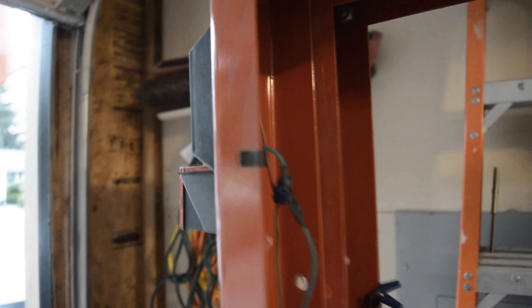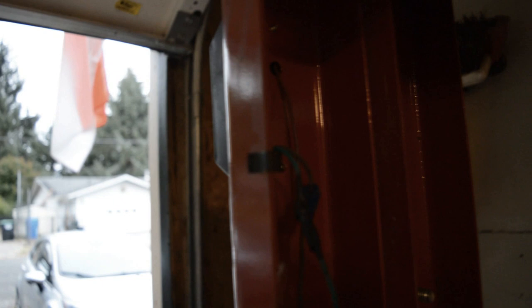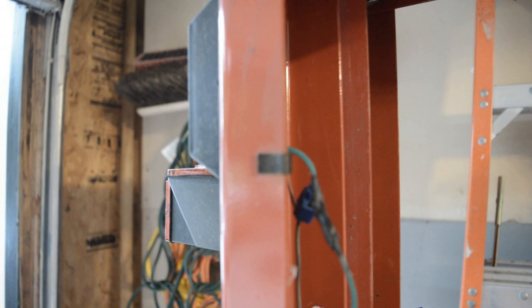On a Chinese trailer, this is how your wires are held down — with these little clips here. They're made out of spring steel, they're sharp as stink, they have a lot of rust on them, and I think they're probably one of the leading causes of tetanus in the state of Tennessee. So what I'm going to do is take these off, drill some holes, put wire ties in, and try to bring down the incident rate of tetanus on the west coast.